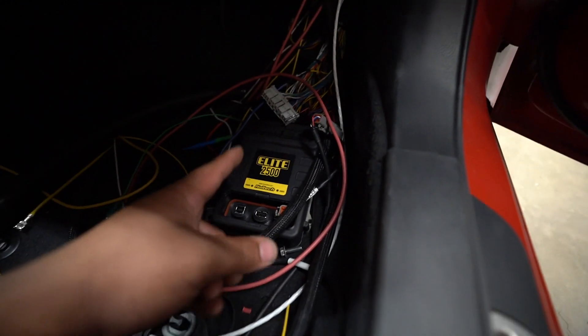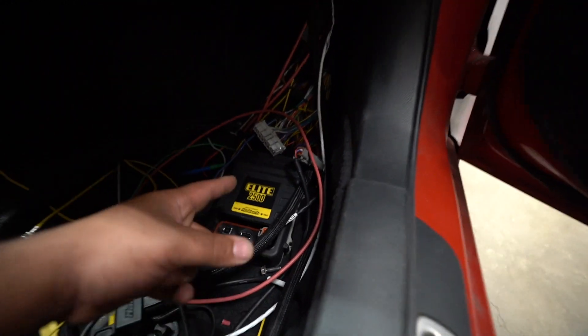Inside, looking at the spaghetti mess — it's good. I did the stuff Ryan asked, switching around some pins, and I got my relays in. So what I can start doing is wire up my fuel pumps, and then I'll be able to place these where they need to go for power and ground until I get more wire on Thursday. That's what I'm going to do today.